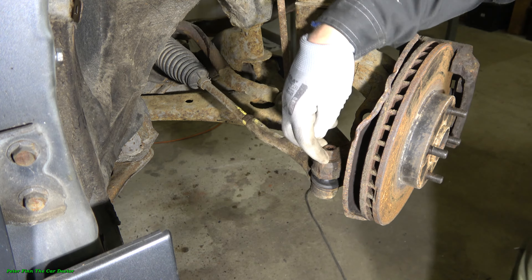There is a hole right here, and I have to open it this way and pull out. There is one bolt that I have to open in this area until it is free from the steering wheel. I open this bolt using my socket — it's 12 millimeter. Using a slightly longer bar and impact driver, I can open this bolt easily. Now the bolt is free.